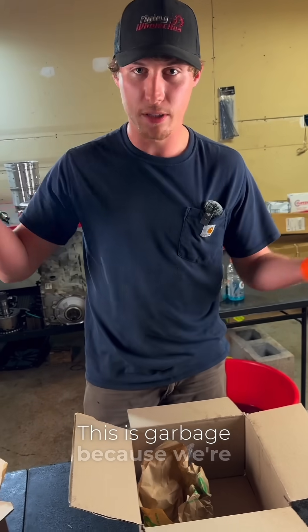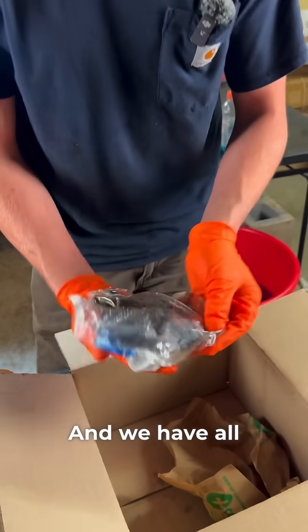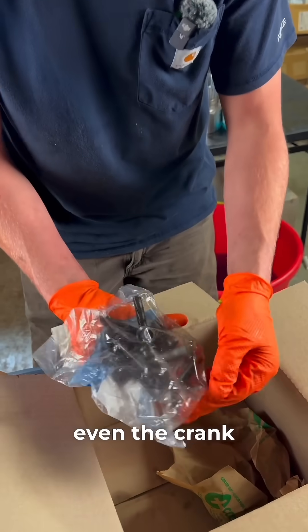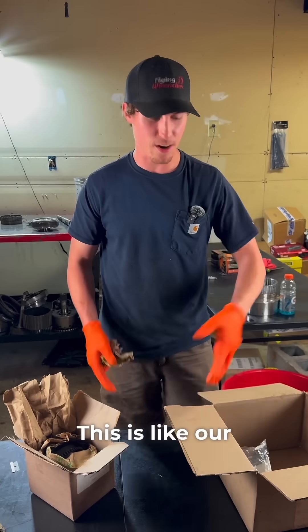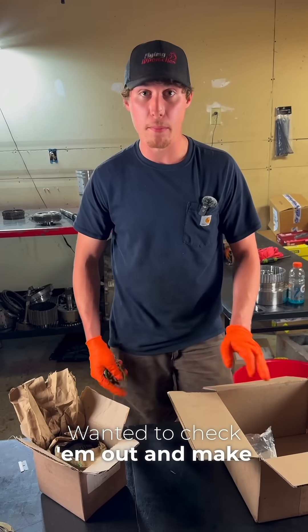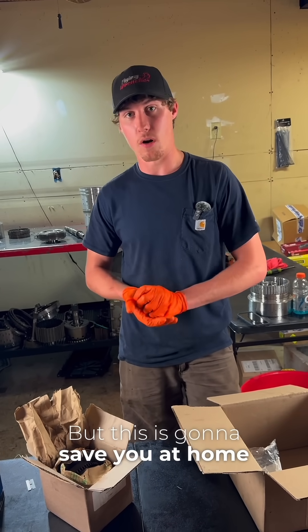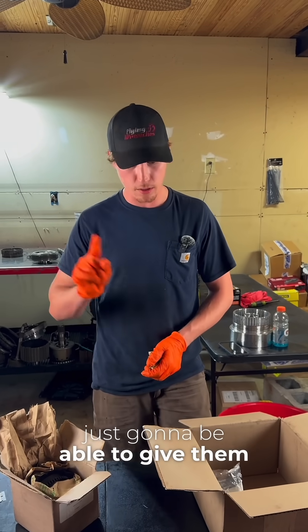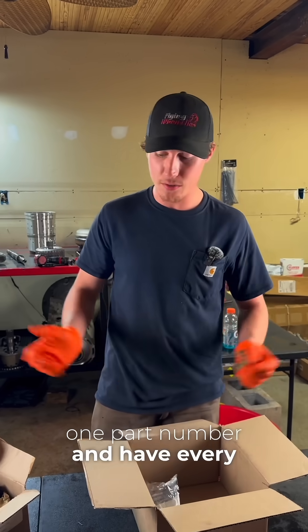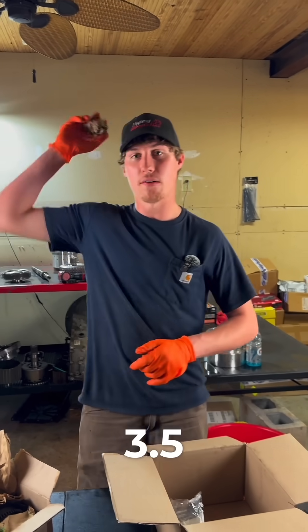We also have a water pump gasket — though we're going to put a new water pump on it obviously — and all of the bolts, even the crank bolt. Super stoked for this cam phaser kit. This is our third or fourth one; we wanted to make sure they were legit before telling you guys. This is going to save you a lot of hassle at home — just one part number and you have everything you need to fix the cold start rattle issue on the 3.5-liter EcoBoost.